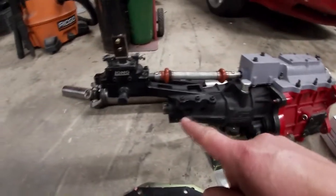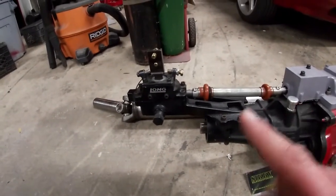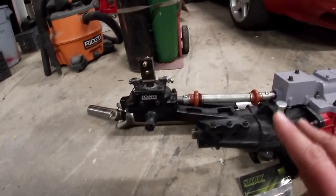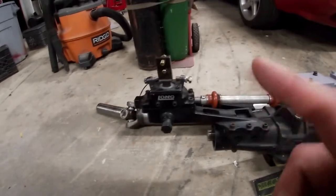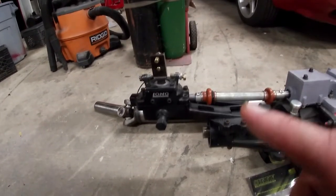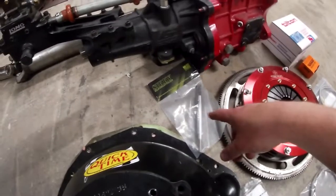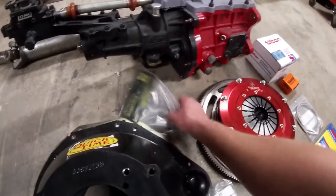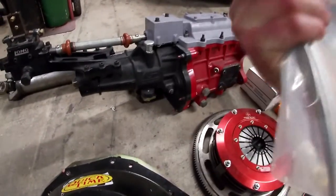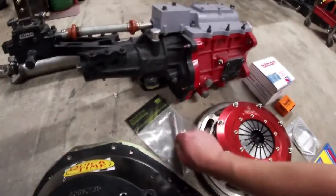For the S550 cars we're going to use the long shifter. For the 4.6 cars you're probably going to want to use the medium shifter, just because on the MT82 the shifter is set way back. This one actually needed the firewall cut a little bit because it's just not quite long enough. I found this sticky shifter — it needs a little bit of modification, just ground down on the bottom a little bit. This is an extended shifter, SRRT04. Pretty cheap solution for a shifter rod.